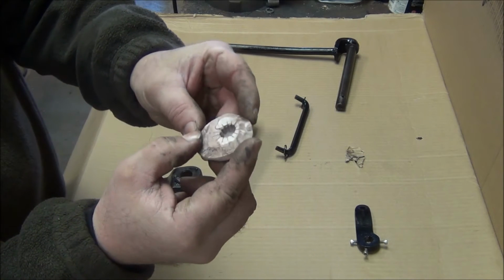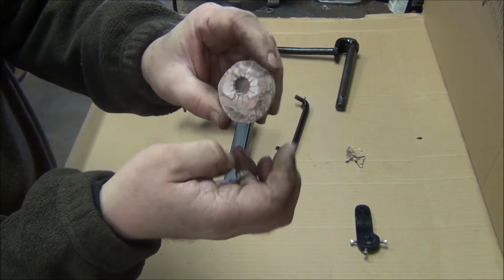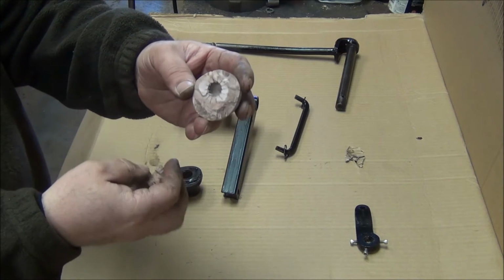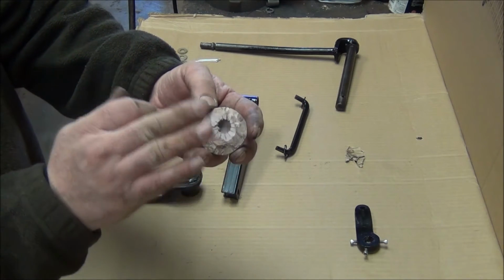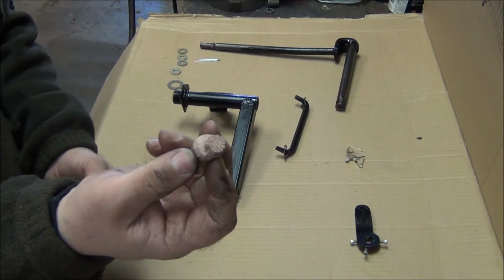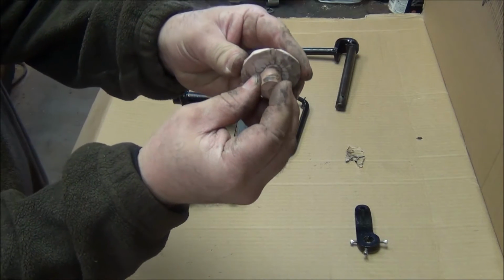There's one spot on here, right there, where there's the one spline missing. It has a little extra rib on it. I took this, sprayed it down with canola oil, just a spray oil, put Bondo over that and let that harden, and I ended up with a positive of it. So I had a mock-up of my spline shaft off the transfer case, and then the two of those just nest together.